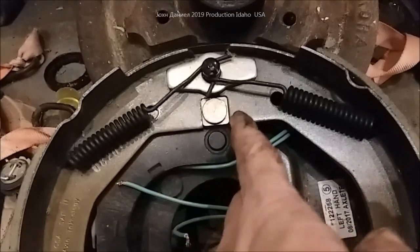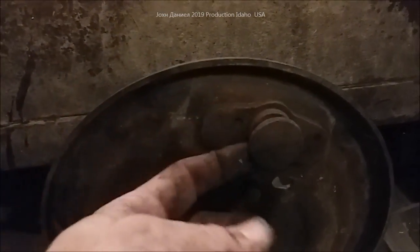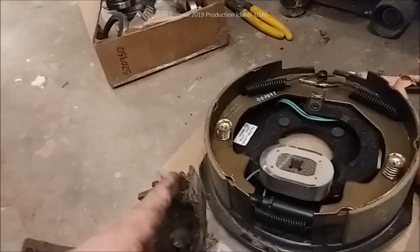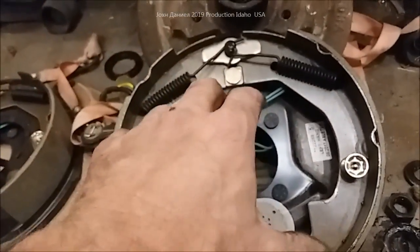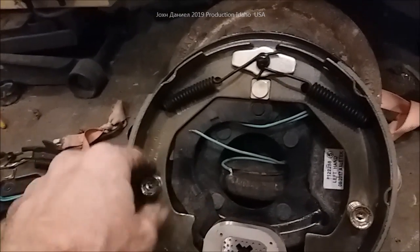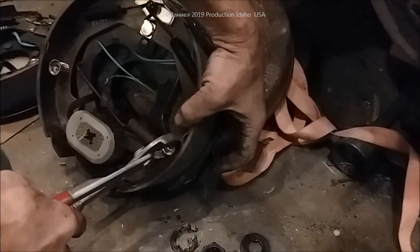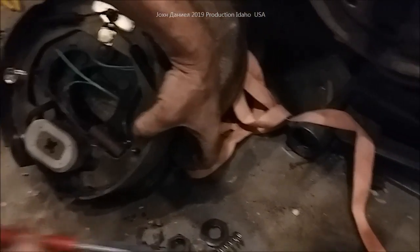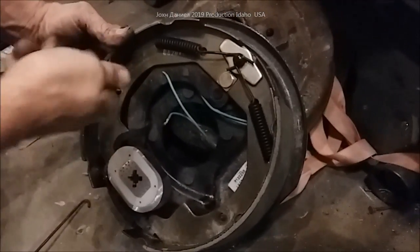You'll have maybe a thirty-second of an inch bigger gap when you're done because of the size of this right here. Some people will take the inner part of the brake on the new ones and grind them a little bit to make it tighter, but it doesn't make that big a difference — these grab better, expand harder, and work better. So you can't just bolt this here onto the surface of this. What we're going to do is disassemble by taking these two clips off, these two brake retainers off. We're going to hold the back of the pin as it travels through the back, give it a little spin, and remove the spring. Push down and twist and they'll come off.